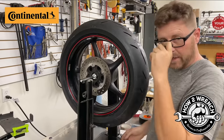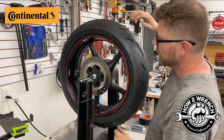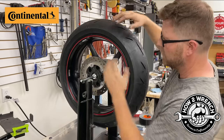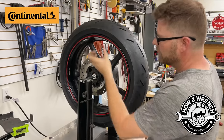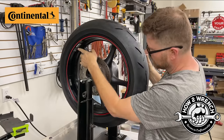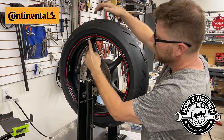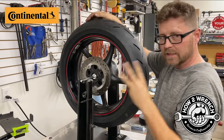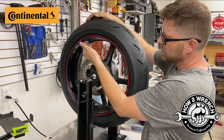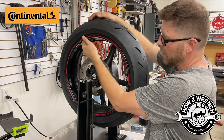To fix this right now means this is the heavy spot, right? Okay, it means I'd be adding more weight up here and I'd rather just start over at this point than adding more weight to this. Because what may happen, there's three chunks of weight on here. These look to be quarter ounces too. There's three chunks on here, but the thing that might fix this is still three chunks, but just moved to a different spot. So 3/4 of an ounce, if you will, right?